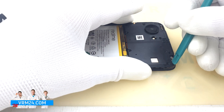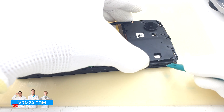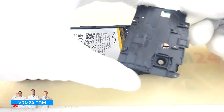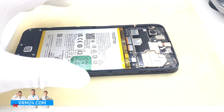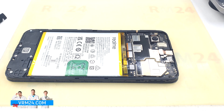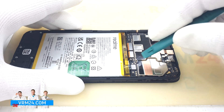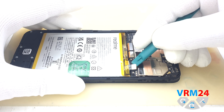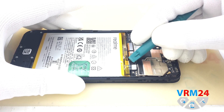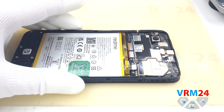To remove the cover it will be convenient to use tweezers, but since we have not yet disconnected the battery connector, we will do it with a plastic tool. We detach the clips and that is it — remove the cover. This cover protects the circuit board and there is nothing on it. You can theoretically disconnect the battery connector with a metal tool because there is a platform around it, but the first time — or as I am telling you now — it is better to avoid metal tools so as not to make a short circuit.